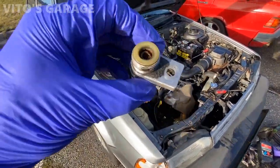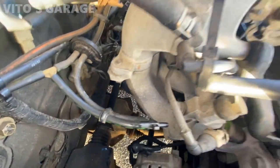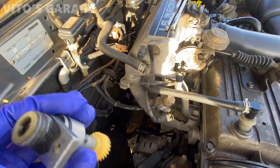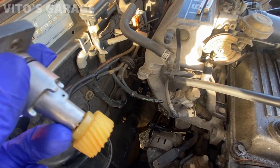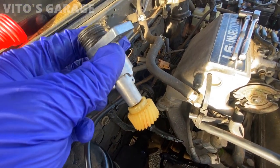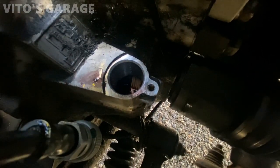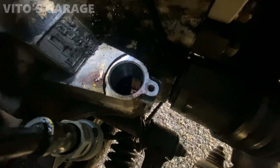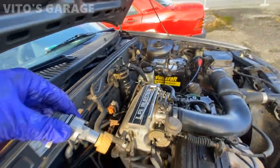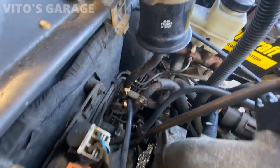This is the gear I was talking about — that's where the speedometer cable goes. To check the level you literally just install this all the way in, pull it out, and the level has to be just slightly above this plastic gear. You can see the fluid right there, and here's the gear — I'm gonna install it and we can check the level with that.